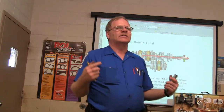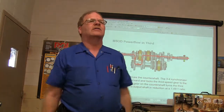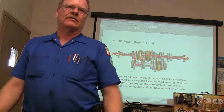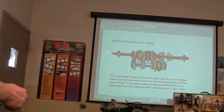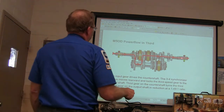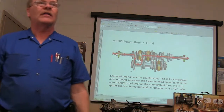And I can go through this until I'm blue in the face, and I can set the thing up on the bench. We can talk about it. I can show you. We can go over it. And people sit here and they sweat bullets and they cry and all other kind of stuff because they can't remember the dadgum power flow. Burn this in, okay? Don't forget it. This goes in, goes down, goes up, and goes back. I will tell you, though, that I rebuilt manual transmissions for 6 years and didn't know how they worked.